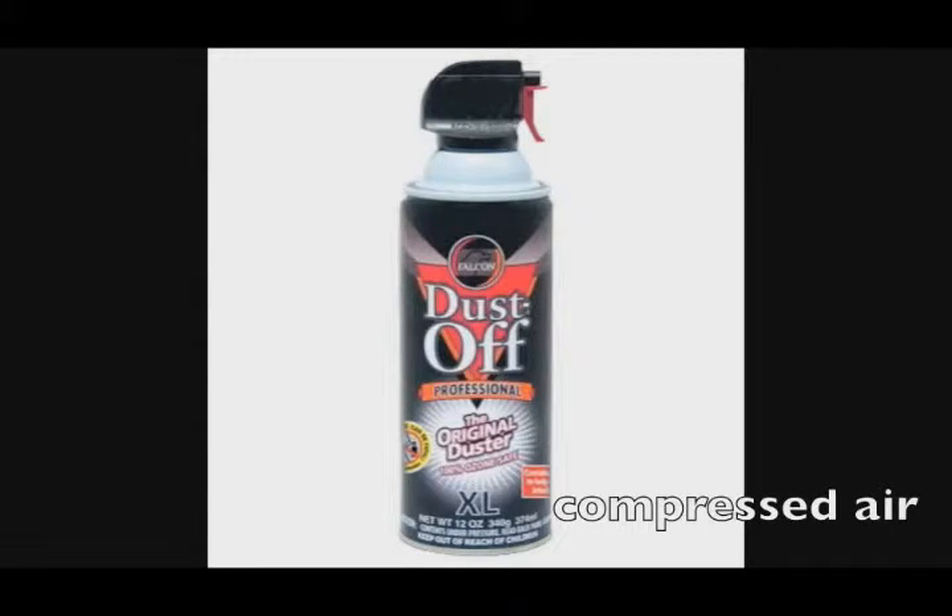Compressed air — you'll see that I use compressed air a lot when working on laptops. I use it to clean out dusty areas, blow out the CPU fan to get all the chunks of dust out, and also blow air through the fins of the heat sink to clean that out. The only problem with compressed air is it's expensive, so if you're going to use a lot of it I recommend using the blower on a wet/dry vac, which I talk about later in this video.